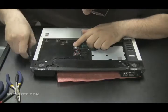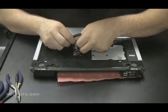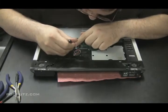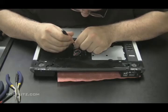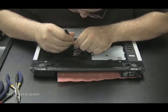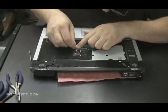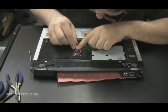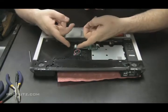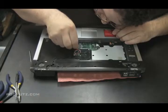So just take your time, use a screwdriver, tweezers, whatever tool you need to. Take advantage of the hard plastic piece they have at the end there, and just try to handle it from that plastic piece. Don't try to bend the wire too much or the ribbon too much. Use your fingernails, use whatever you can. This one's giving me trouble, but I'll get it in.